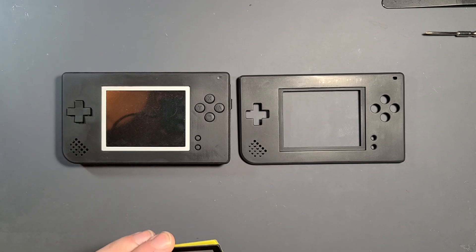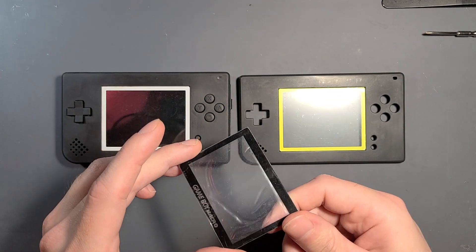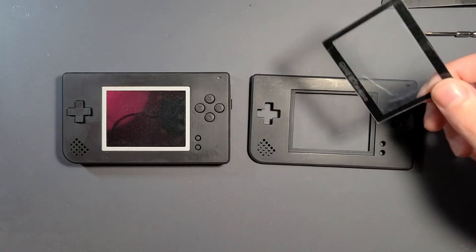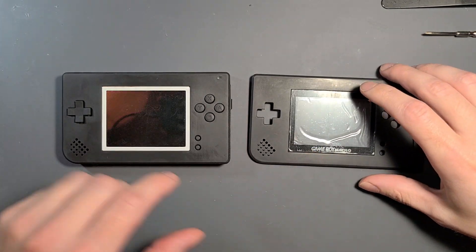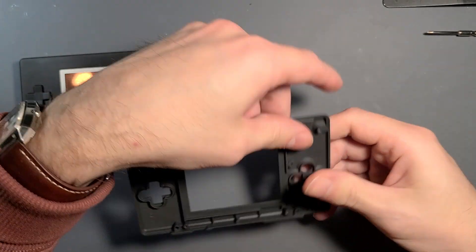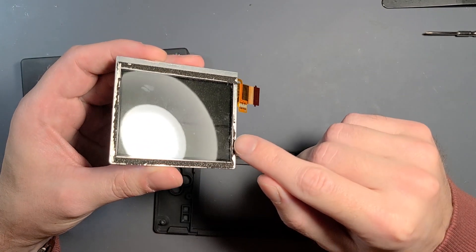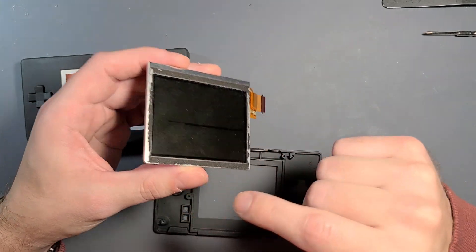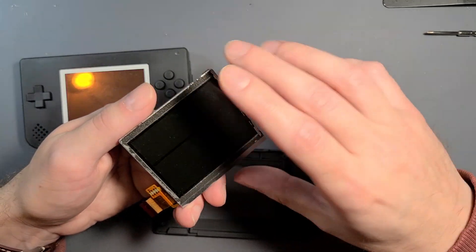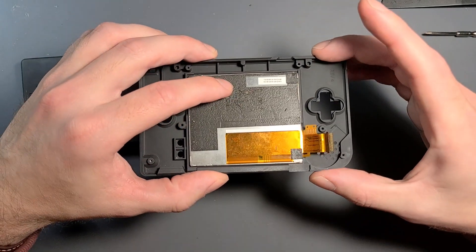With my design I have a couple of options as far as lenses. There's a plastic lens that you could have seated if you remove the digitizer, and there is also a glass version — this is the more common version people use. I find that the bottom part of the bezel covers a lot of the screen. To use a lens rather than a digitizer, you have to remove the digitizer from the LCD. The glass lens or plastic lens can look really nice compared to most digitizers, which are worn out at this point with a lot of scratch marks.